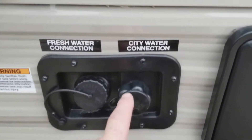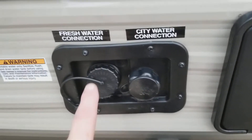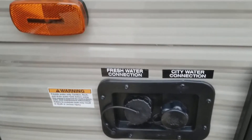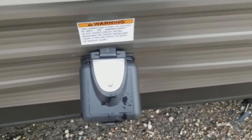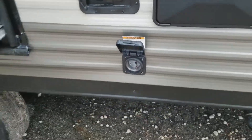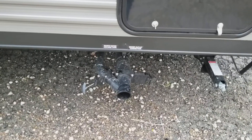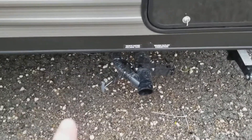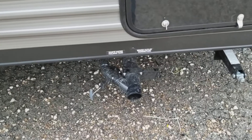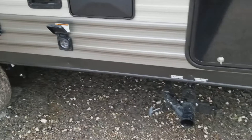There's your city water connection for your constant water. When you have constant water on here, the pressure feeds through and you do not have to have a pump on. Then you've got your fresh water where you can fill up your tanks. You can turn your pump on and it will pump everything through. Here is where your 30-amp service is — we'll give you that 25-foot marine cord. And right down here is where you flush your tanks out: gray water is your sink and shower, black is your toilet tank. Do the black first, then the gray to help wash out the hose.